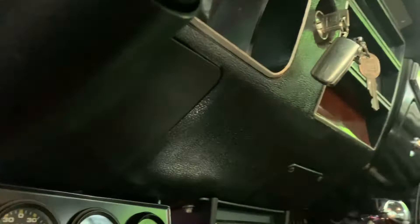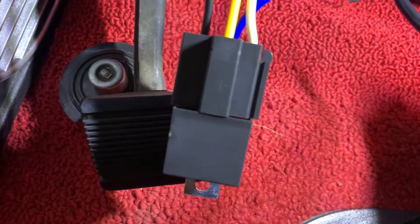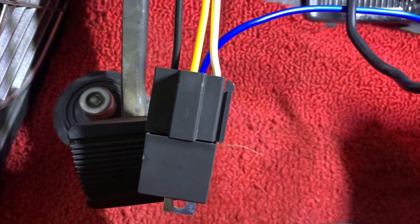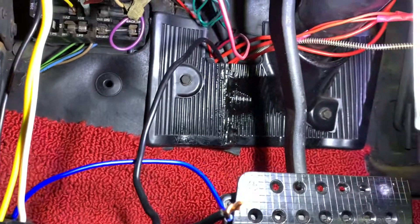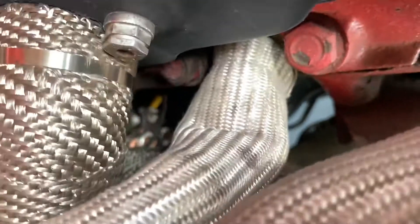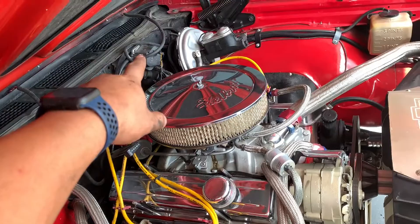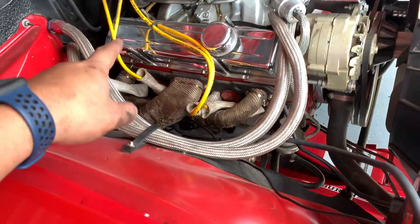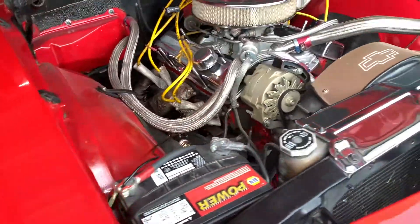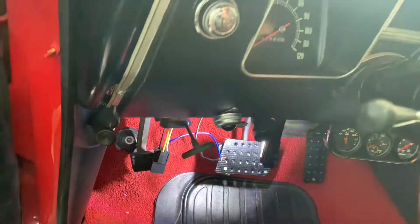When I turn the key right now, the relay should click — let's see. I don't know if you can hear that but we had some clicks going on in the relay, which is perfect. Let's go hook up the wire at the bottom and then hook up the black wire to the battery and we'll test it out. Down there you'll see the yellow connector — that's the signal wire, that purple wire. That one's the one that's still hooked up from the factory side, cut underneath the dash, with the blue or yellow wire leading into the starter. The black wire is temporarily hooked up. Ideally, the car should start now — let's see what she does.